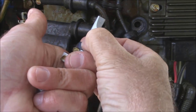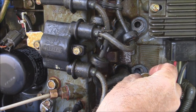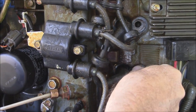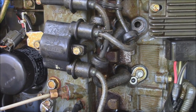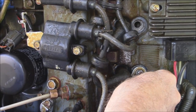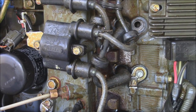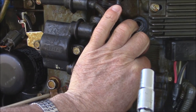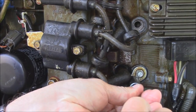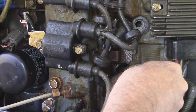The flat part's going to go on first. Push the flat part down, it goes in right about there. You can go ahead and just put this in here, push it in pretty good. Since it's a new grommet it's going to be a tight fit. Just line up the hole to it. Put a little bit of marine grease on the end of this one, and that's going to slide onto there. I believe that's a 10 millimeter right here. It should go on there pretty good.